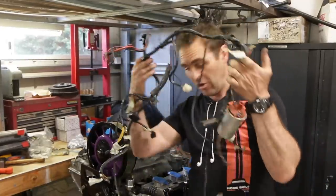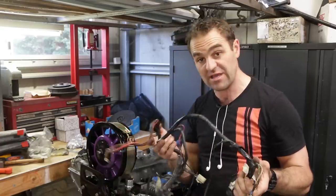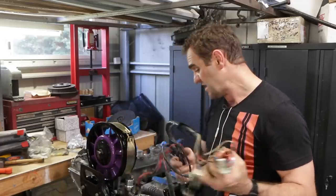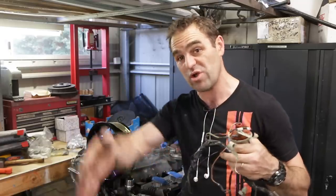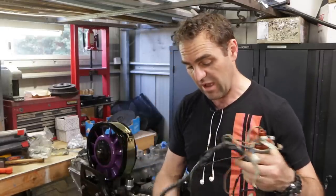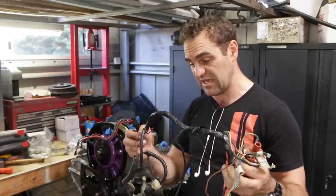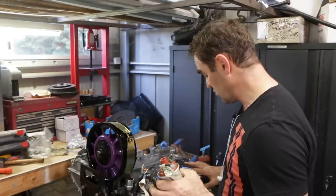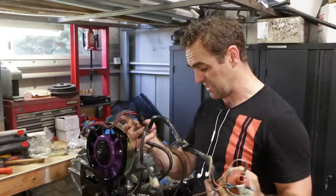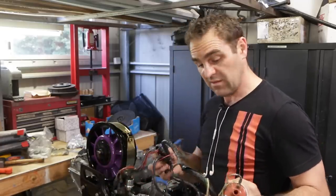The next fun part is going through this old mess of a wiring loom and working out what I do and don't need. There's a lot of stuff I don't need because I'm not using the CIS or an ignition coil, but there are things I am using — a bunch of sensors I still want connected, plus the alternator and starter motor are still going to be wired up basically as they were. I'll probably strip the whole loom down, keep the bits I want, and get rid of the rest. I also have to intermix the loom to cover the injectors I'm yet to add and all of the coil packs. I might just start plugging things in now to work out what goes where and get a rough idea of what's going on with this mess.